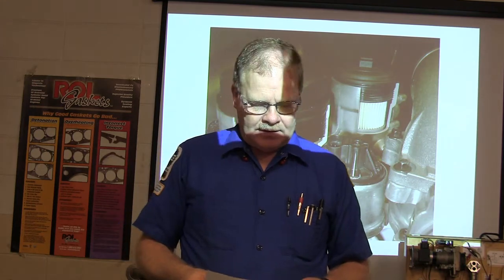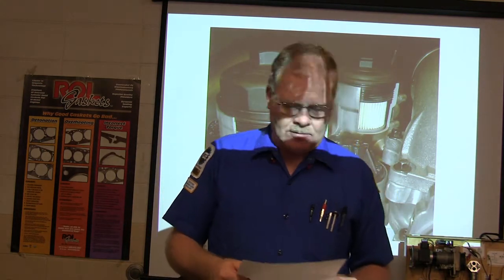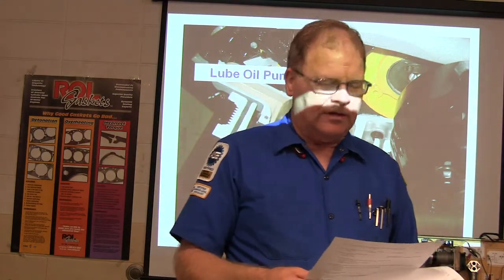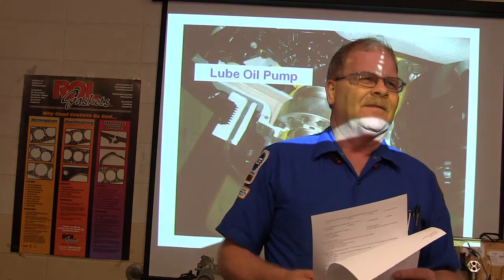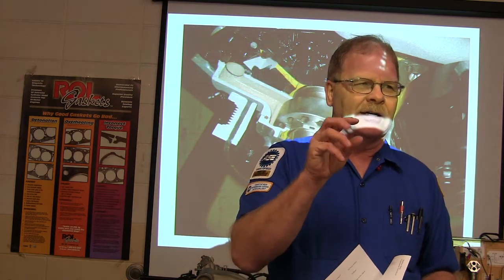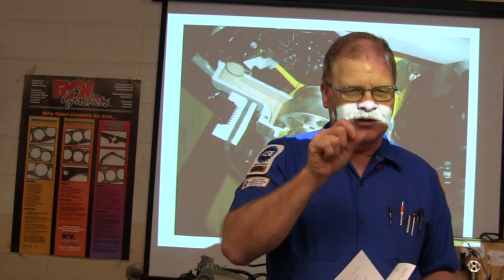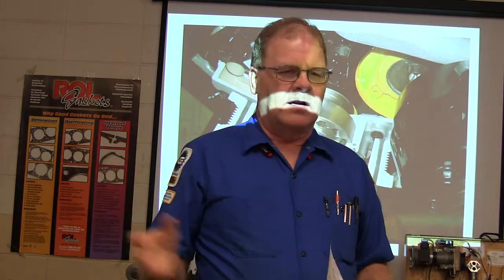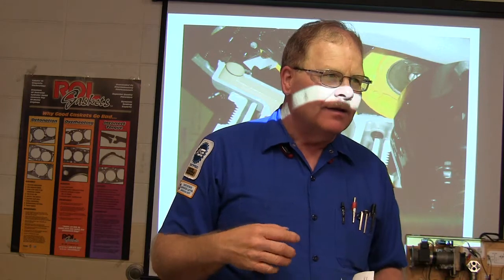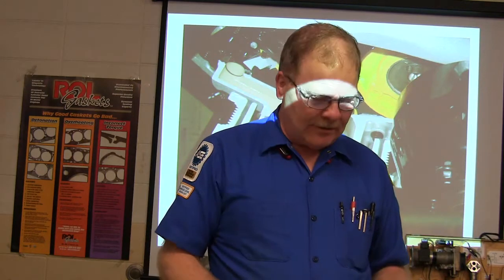And so, okay, Technician A says the Tinnerman nuts used to hold the brake drum on should be reinstalled when, you know what the Tinnerman nuts are? They're little plastic clips that hold the brake drum on during assembly. No, they're not plastic, they're actually a little spring steel thing, and you just slide them on there. And whenever they're running them down the assembly line, they don't want the brake drums falling off. So they just stick those on there and it keeps the brake drum on while they're assembling.